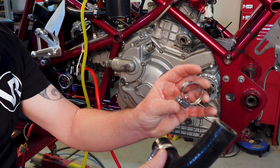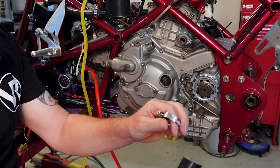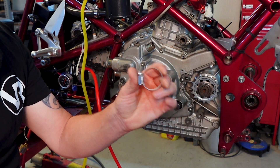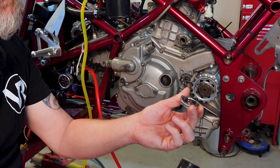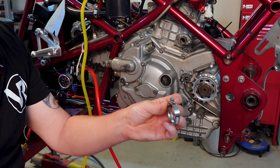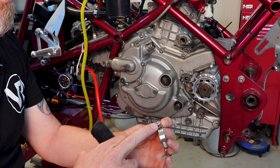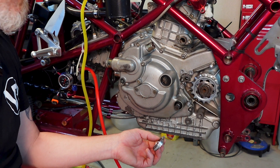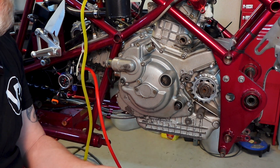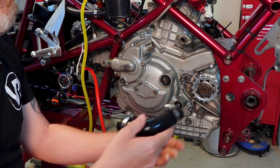We're finding that hose clips or jubilee clips for these are pretty much a consumable item. Even though these are 304 stainless steel, they're not 316, so they will rust again — but not the same way mild steel will. Point of note for building any bike: keep your jubilee clips all the same size. These are 7mm heads, so they're all going to be 7mm heads. When we change the engine again, I know I just need a 7mm socket to take them off — not a mix of 7s, 8s and 10s. That's just good practice. Let's get these fitted.